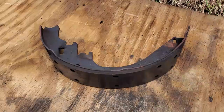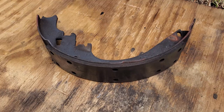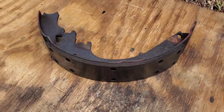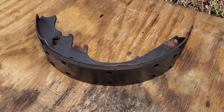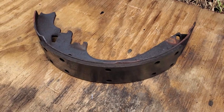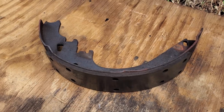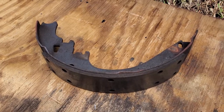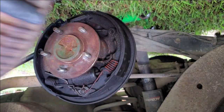When buying brake shoes for a Fleetwood there are two different options. I don't remember the size off the top of my head - I want to say it's like two and an eighth and two and a quarter, something around there. Don't quote me on that but there are two different sizes. I believe the bigger size is for a towing package or a limo, one of those or both. Every Fleetwood I've owned they've had the smaller brakes - I've had five of them and all have had the smaller brakes as far as the shoes. Keep that in mind when you go to buy. Usually it is the smaller ones. When in doubt I do try and buy both, but a lot of times they don't have both sets in stock and I've usually gone with the smaller one. Unless yours has a towing package, chances are it'll be the smaller shoes.